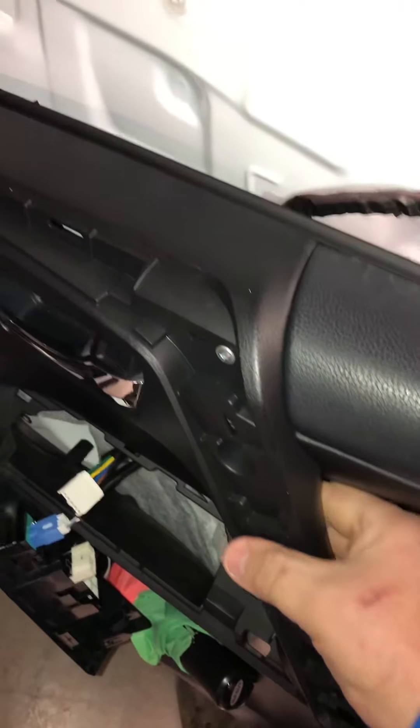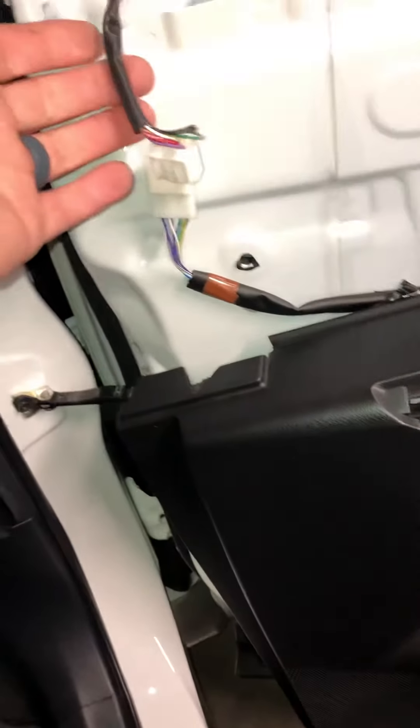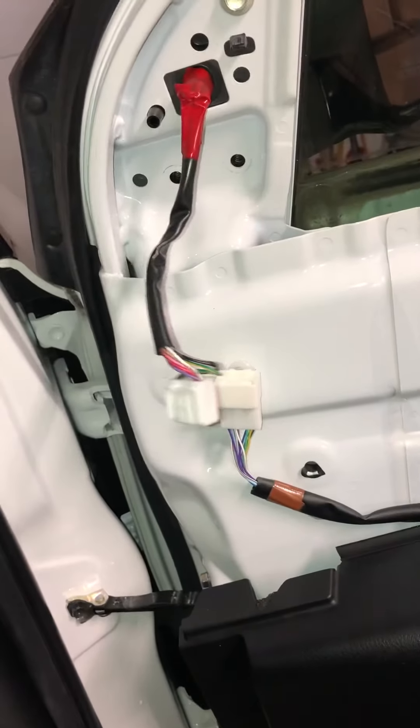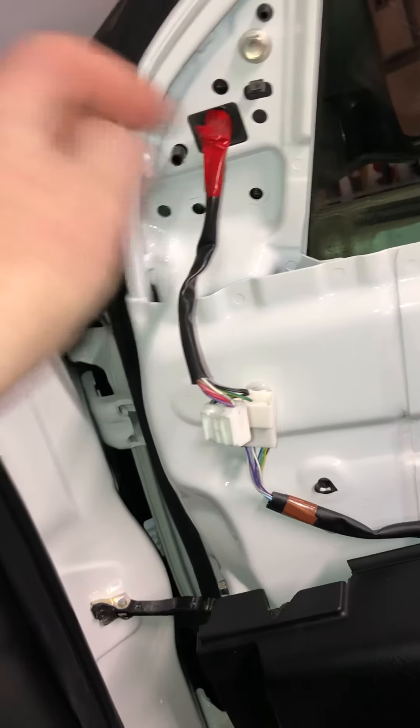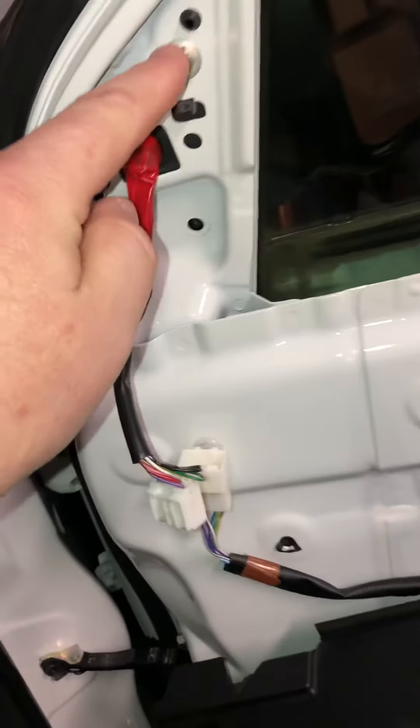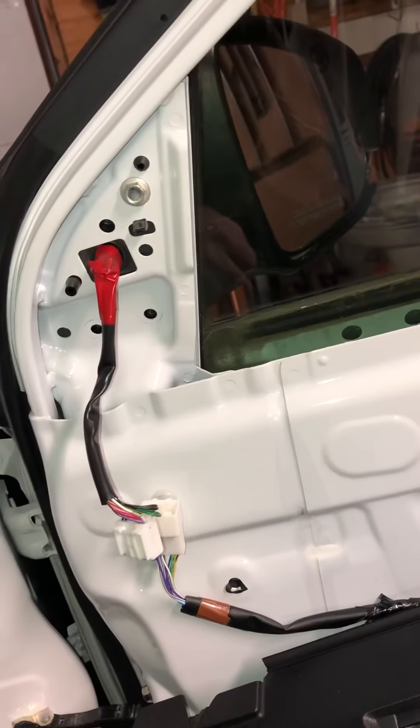You'll only be here for just a moment — let the panel hang just like so. There is our connection for all the goodies on our side mirror. The plug is right here — it's just a pinch and pull. Now don't forget those little clips on the side here. Take those out, take that last bolt out, and we're ready to pop the mirror out.